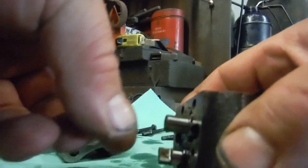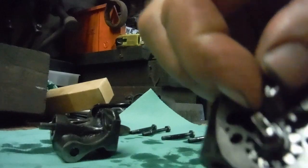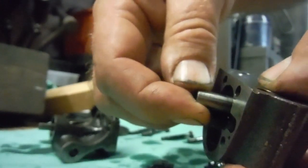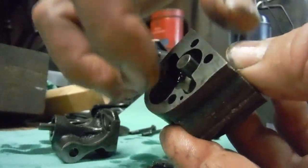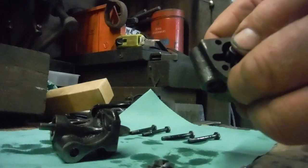Further investigations led me to stripping down the oil pump. Whether the camera will pick it up or not I don't know, but that spindle there is pretty wobbly, as is the gear — this one also. I've taken the gears and shafts right out of the pump and there's no scoring as such, but there's obviously wear. It just proves that the pump housing doesn't actually have to be scored to be worn out. That spindle passes right through the bulkhead between the feed side and the scavenge side, and with that wobbly fit, any pressure you build up on the feed side is going to escape straight into the scavenge side without even getting pumped into the engine.